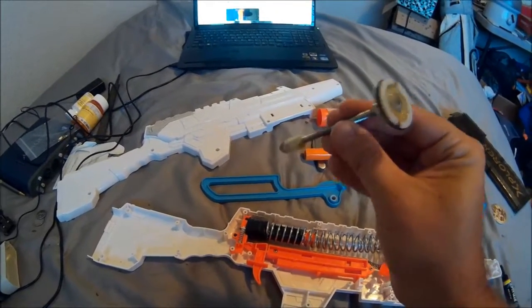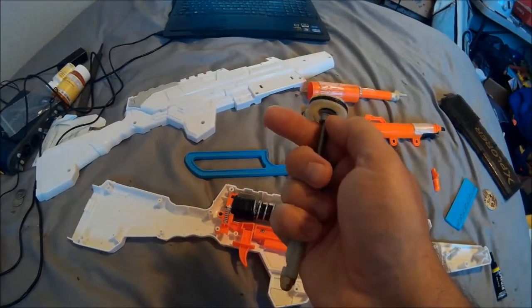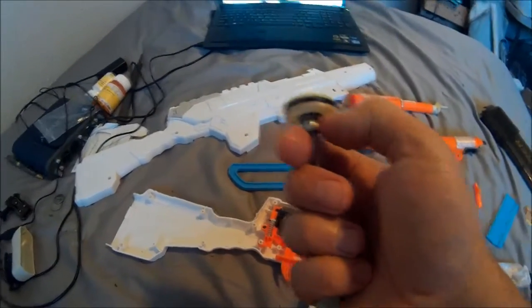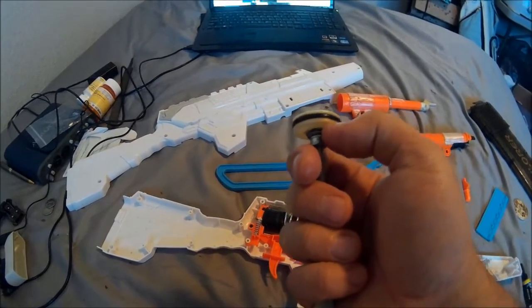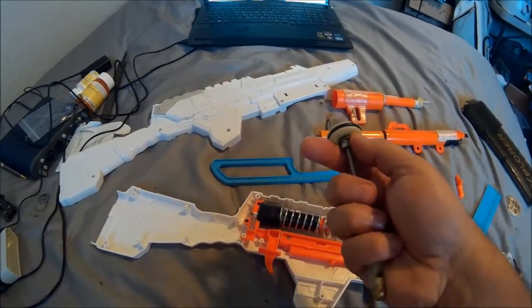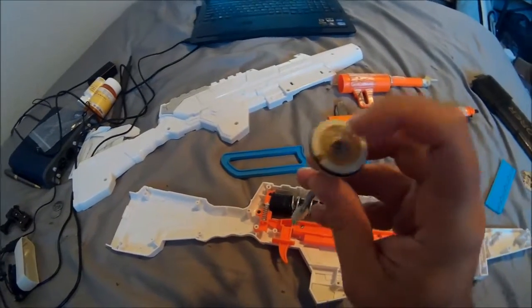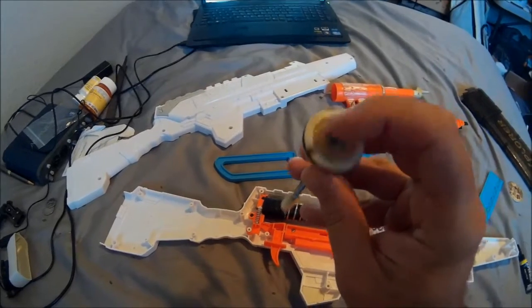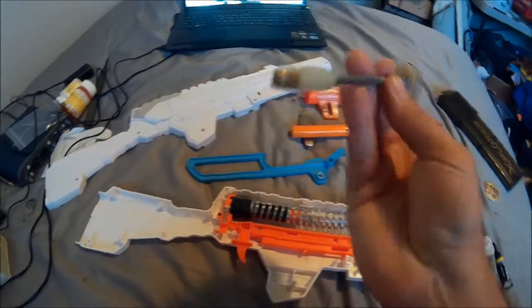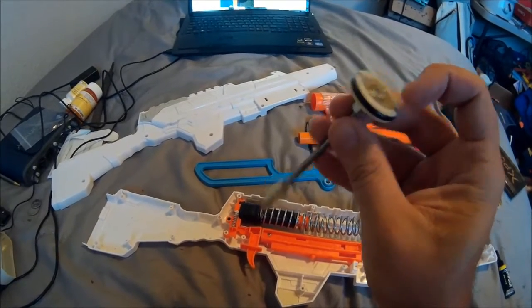It works fantastic. I wanted this to be adjustable, but then found that that's not a good idea. So this lock nut right here is probably going to be changed with a normal nut that's glued. And instead of a neoprene back washer, I will probably just use a washer back here. Probably a nylon washer back here, nylon washer up here, and I will probably just use a normal screw here because I had to file this down so it wouldn't hit my pad. Because that's also a number 10-24 lock nut. And then I filled the whole thing with epoxy. And I don't see any cracks. I don't see any problems. This thing has been driven really, really fast, okay?